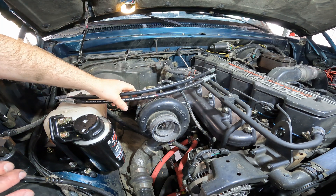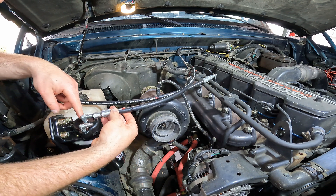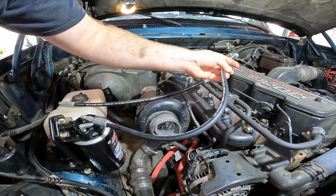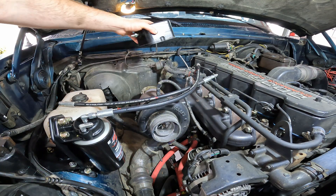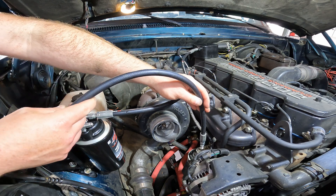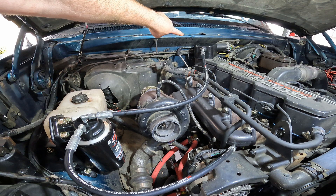We've attached the filter head — she's solid. We can test it with our filter — perfect. We've got our two hoses and our eighth inch MPT 90-degree fittings. We want the top center one for the long hose. We actually have enough room, so we might do cylinder number six. Here we have our fitting with our bung and the extra valve cover — we'll toss that up to see. Here we have our feed. We'll pull off the decorative cover and valve cover number six and swap it out with the modified valve cover.